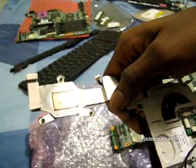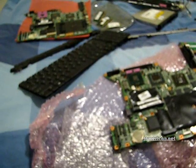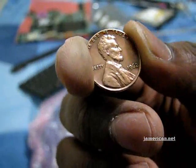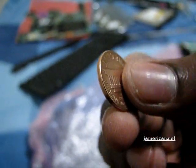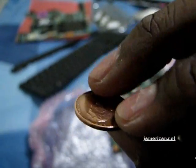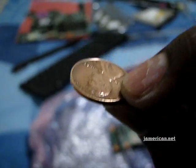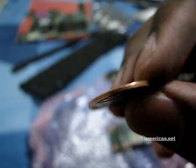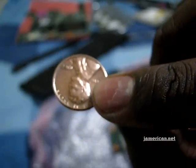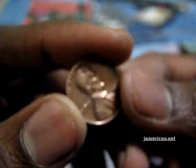The GPU heatsink again has no fan connection to it, and your CPU Northbridge heatsink has the fan connected but there is no copper connection to that Northbridge. Therefore we use the copper penny — this 1962 penny is not the best thing to use because of the surface roughness that doesn't allow for good contact, but being conservative it has actually done a great job for me already. Make sure to clean the penny well because most likely it'll have a lot of black crud on it, but after multiple uses you'll see it get very shiny.